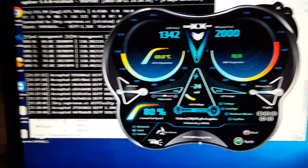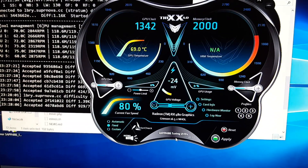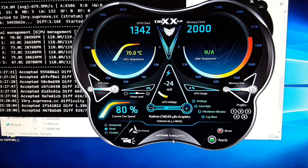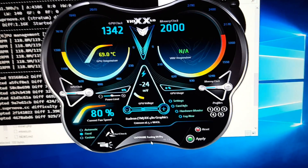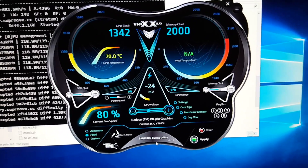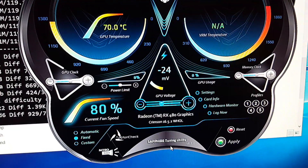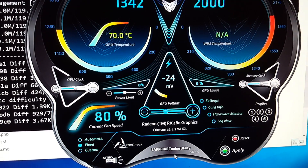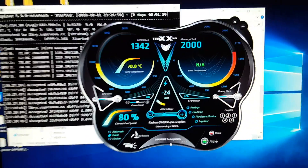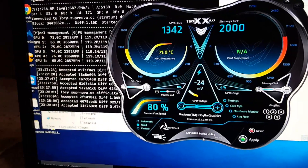I did something a little different to help reduce power consumption — it saved about 80 watts. I went into the settings and lowered the GPU voltage. This is not a necessary step, but the cards can easily handle it. You could do up to 50 millivolts, but I'd start with 20 and move up by increments of 5. I settled at negative 24 millivolts — the system automatically adjusted to 24. I've been running this stably for 24 hours at those settings.